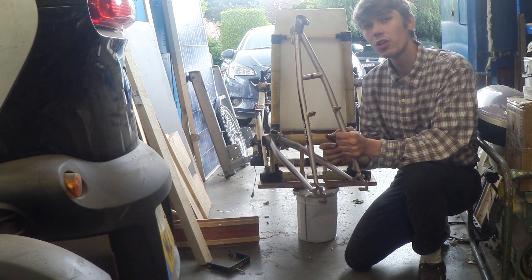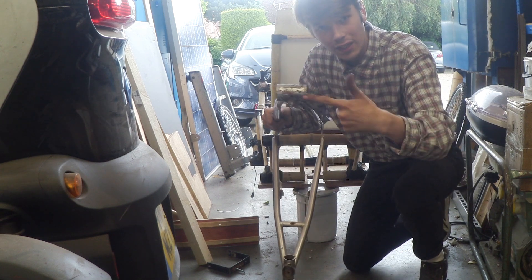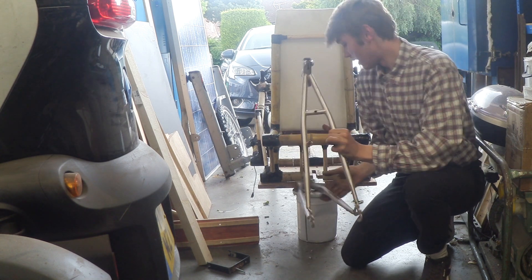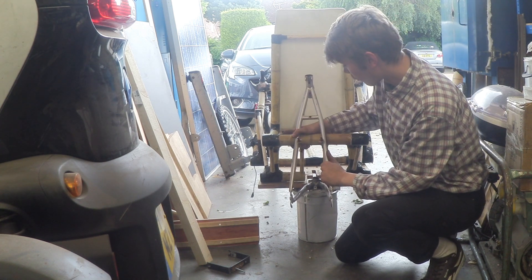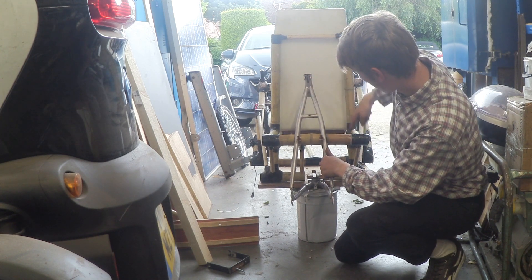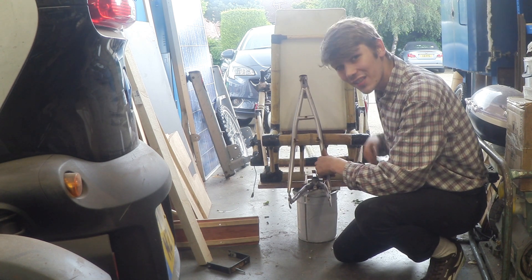Here are my back stays. These need a little modification to fit the wheel and the humongous cog attached to it. I've figured out a way to do this: chopping this section in half both ways so we can extend it out and weld it onto a longer pole. The top bit gets chopped here and here, pushed back into the original position, and these top pieces get wrapped against the frame. The middle section gets cut out, and we need to make sure the frame has enough support, so we'll add supports here, here, here, and here. The bottom will be attached the same way the original axle was — just with a couple of U-bolts. Now that we know the build process, let's get on with it.